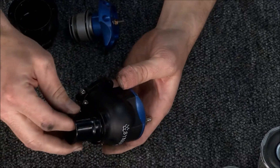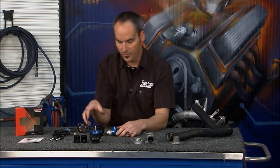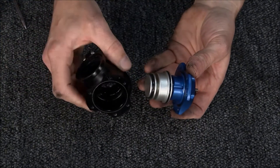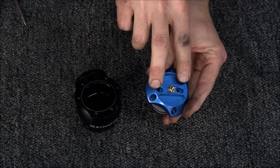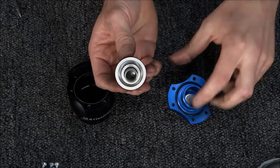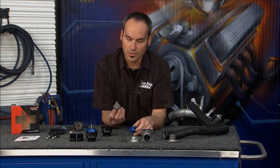It's got different adapters — hose adapters on both ends — so I can put it right into this system. Now inside, it's anodized, it's blue, you get different colors and can trick it out. But what's neat is inside there's no diaphragm. They've come up with a very clever system of different ports that are machined in here, and they act on different diameters — different areas and different forces. Depending on how you plumb these ports, you can make this valve act faster or slower based on how you drive — whether you lift throttle real quick when you shift or let off the throttle a little bit slower — so you can tune that.